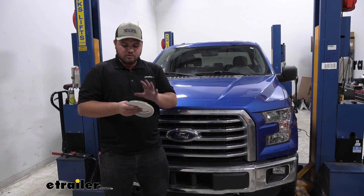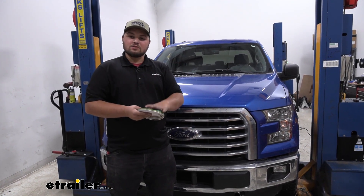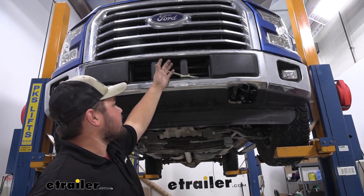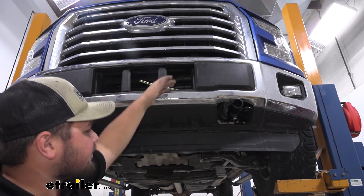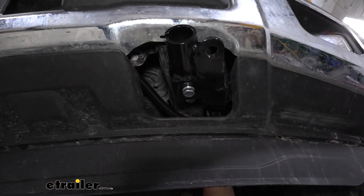To start our installation, we want to run our diode wiring from the front of our truck all the way to the back. I'll go ahead and do it and then we'll show you how we routed it. I tied off a little extra of our diode wiring here in the front, so if we ever have to change it or make any connection we do have a little bit of extra. I cut a slit in this plastic, pushed our wire through, and pulled it out down here by our base plate.